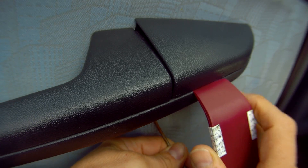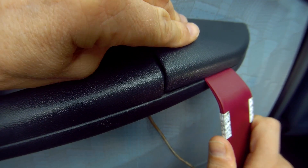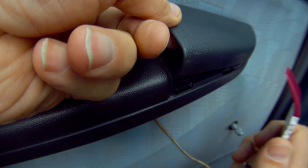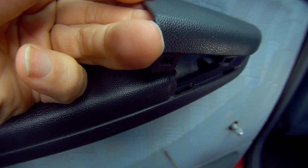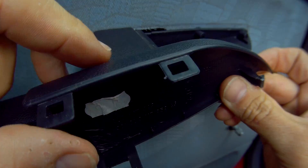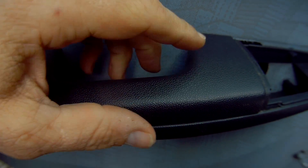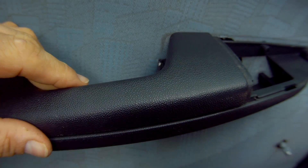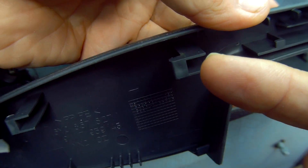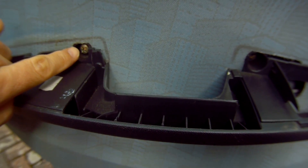Once you've got it off you can see exactly how it clips on. Once you've released the back, push gently something firm and protective into the crack at the front to release two further clips. Plastic trim tools are ideal for this, but a screwdriver will suffice if you protect the end. Carefully push against the clips to release them — just take care as this plastic easily marks. Disconnect the electrical window switch if you have one. The remaining door handle panel simply slides satisfyingly forwards to remove it. Underneath you can see all the hook connectors running all the way along it. Put that to one side and you've revealed the two large Phillips screw bolts that need to come out.